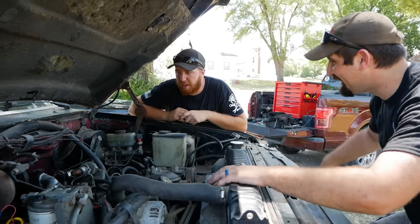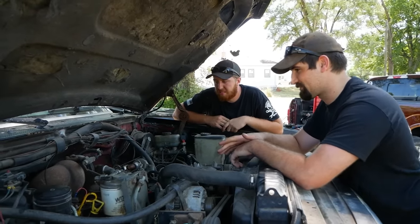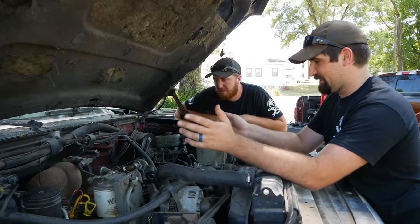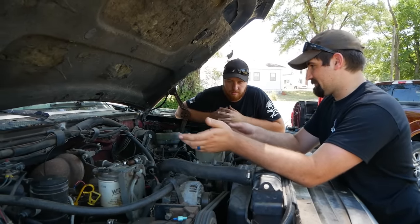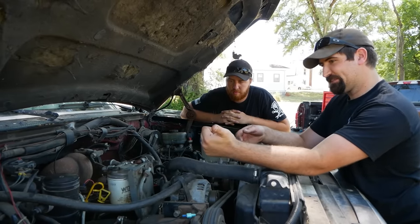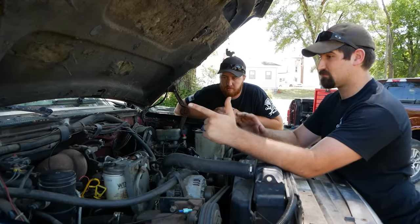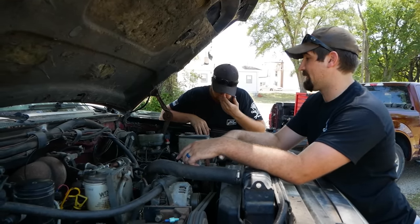She'll run. She'll be fine. But, yeah, the amount of gas coming out of there has got me a little bit of concern. These are a high compression engine. They rely on the compression to ignite the fuel. Watching the videos the other day, it looked like you were running into two issues. Fueling, possibly even heat slash compression from either your glow plug system or the atrocious amounts of blow-by.